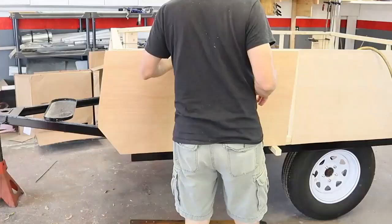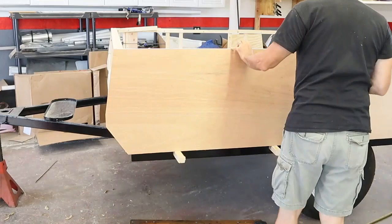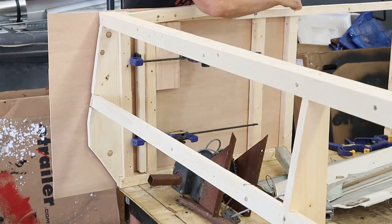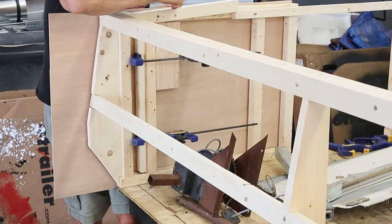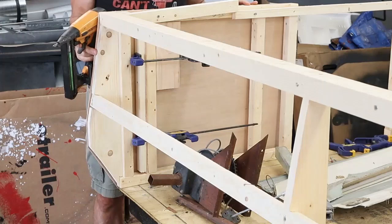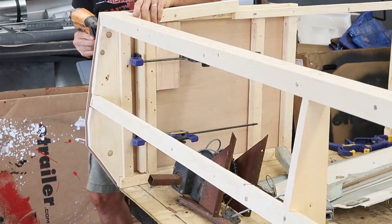On the sides, I had to use two pieces because one piece of eight-foot long paneling will not cover the whole length of the trailer. Showing you on the passenger side, the small panel in front of the door and you can see how I'm tracing it out and fitting it from the inside. The staples I'm using are about three-quarter inches long, so if you miss a stud they're going to stick out through the paneling. It shouldn't matter, but it's just something to be aware of.